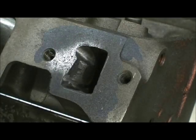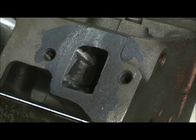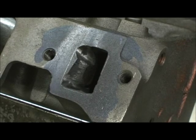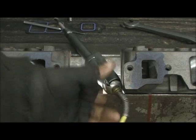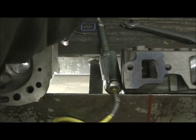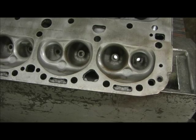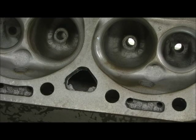I pretty much treat it just like an intake port. I go in there and make what I call my little baby cloverleaf, then come in with the big egg and straighten it up. I completed my little bit of trenching and straightening the water ports out. Now let's roll the heads over and take a look at what a mess comes from the factory - sometimes it's bad, sometimes it's worse. See all this casting flash and overhang.